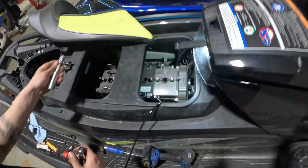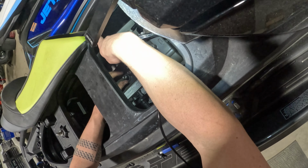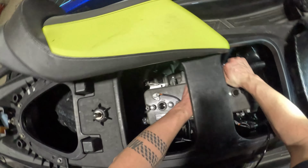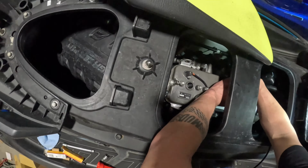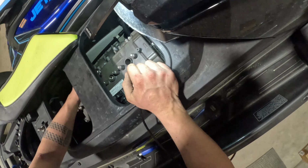Always hit the outside three and then build up and get a little creative with the combination for the one under that cross member there. It's typically a deep socket with a 3-inch extension and just the ratchet. It is a very close fitment to the valve cover, but it does work just fine.